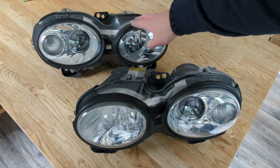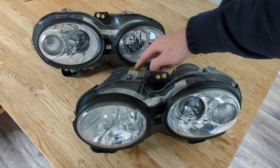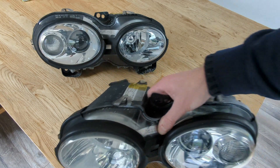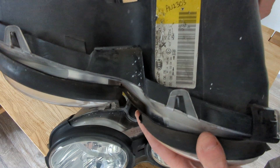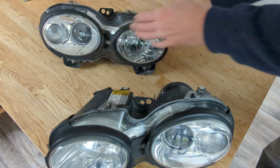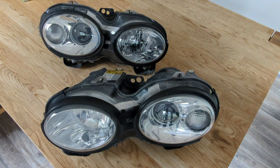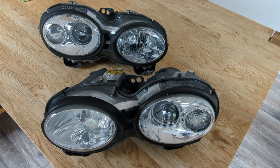Unless your eyesight is particularly good you won't be able to tell much of a difference, because the lenses are only slightly different and the labels are entirely obscured. You can see that one has a little electrical symbol on it to warn about the ballast and igniter system, and the halogen one does not — so that's a dead giveaway — but it's not going to be possible to see because it's usually hidden under the slam panel. Both lenses have markings that say D2S, so that's not going to help you either, principally because the same lens is used on both headlights.